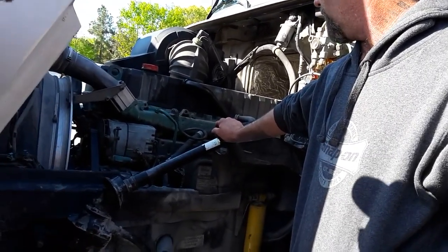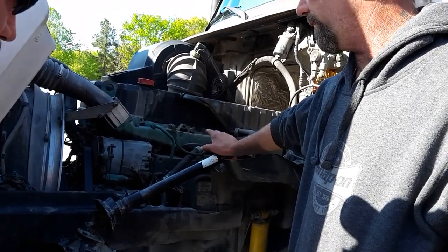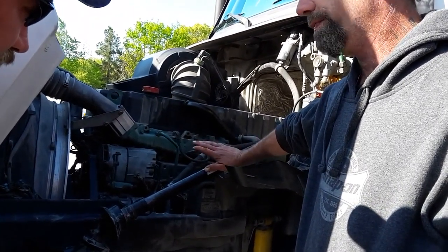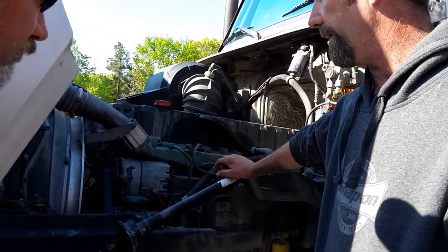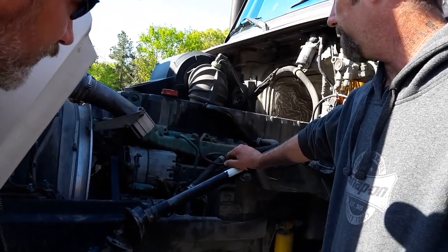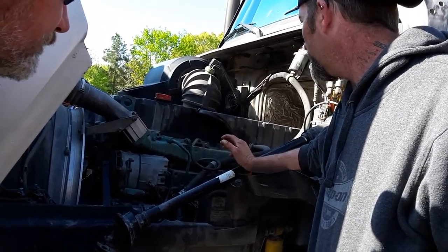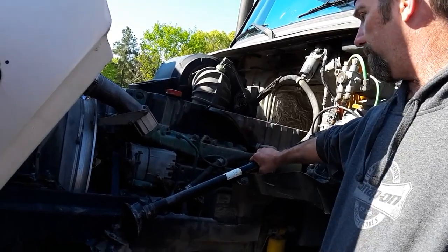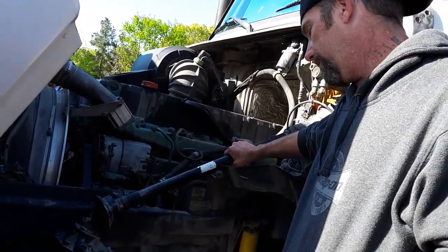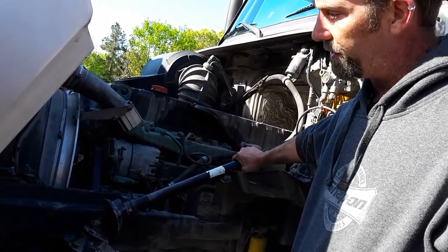All right, driver, continue. I'm doing a general inspection of the rest of my hoses and electrical lines, or my electrical wire. Okay. So probably secure, not cracked, not broken, no fraying. Okay. Driver, is there anything else you'd like to tell me about this side of the engine compartment? No. All right, you may continue, driver. Taking my steering rod. Yep. Probably secure, not cracked, not bent or broken, no missing nuts and bolts.